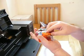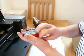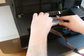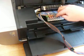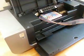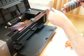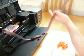There's no ink coming out of the cartridge for two reasons: one is because we've closed the roller, and the second is because I'm working with the cartridges held higher. We're going to turn it upside down and put them all in in one go, then clip them all into place pushing down. You should see all the lines come off. The cable is twisted, so we need to untwist it — as long as you've got all the plugs in, you can actually turn this around and around to remove all the twists.